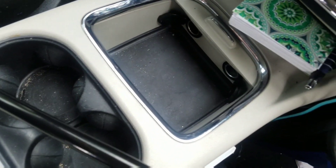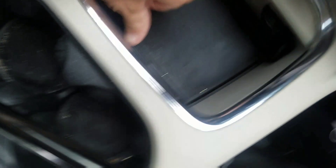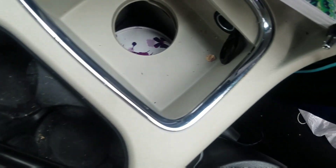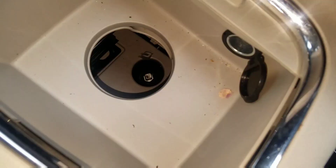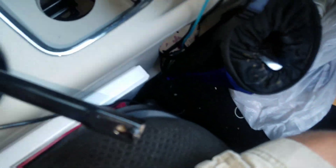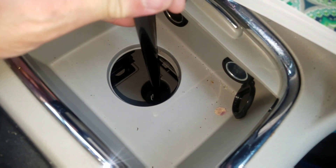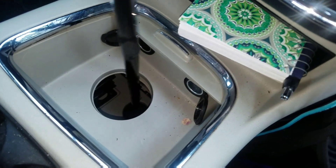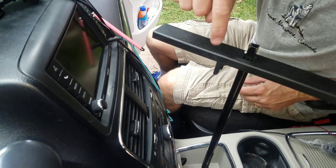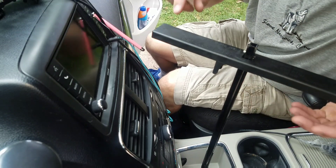If both of these won't fit on your square down there, I put a piece of tape on there so I knew which one goes on the bottom. The access to this thing is right below here, so you've got to peel this out of here and put it off to the side. Then you've got to take this drawer out. Right down here is where you put this tool. So you just put this over that square down there, just like that. Then you just turn it counterclockwise — it tells you right on top which way to loosen and which way to tighten.